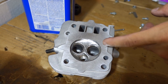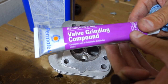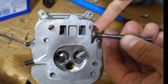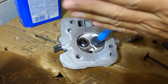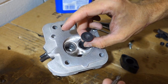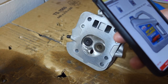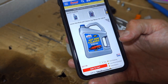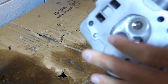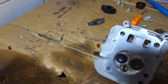The final step is to make sure these valves are seated as well as they possibly can be. Pick up some valve grinding compound and a valve tool, apply the compound on your valve, and work it in. I've verified the seal on both valves and we have a great seal. You want to use some type of assembly lube or high quality oil when reassembling — I personally use Lucas Hot Rod Classic Oil, which is designed for tappets and has a higher zinc content. That's a great way to not spend a fortune on oil.